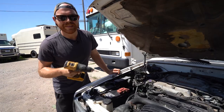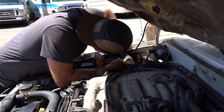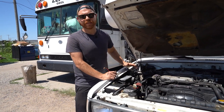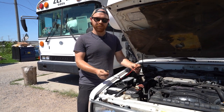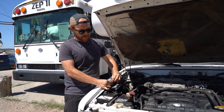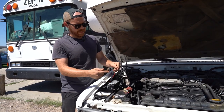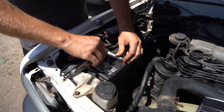Once you have your LEDs mounted, you want to go ahead and ground the relay to the chassis of the vehicle. Once you have the relay mounted and grounded, we're going to go ahead and mount the positive and negative terminals to your battery. One of the cool things that Part Sam did is they put a 20-amp inline fuse on the positive end. You can go ahead and just mount these to the actual lug nuts on your battery terminal.